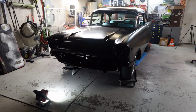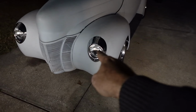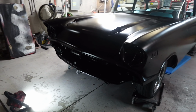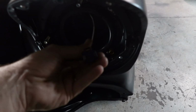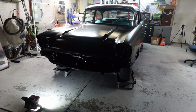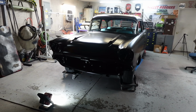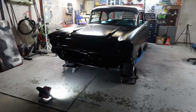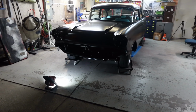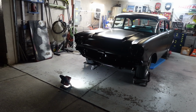And I'm going to send Don out to get me a regular set of headlights, these, from O'Reilly's or AutoZone or wherever he chooses. That's a 3-pin connector that will just hook right into there and not be a disaster. Because I tried to hook up the LEDs, it looks like it'll plug in, but it doesn't plug in. And I'm not cutting the brand new American Auto Wire harnesses and all that. It's just dumb. I'm not doing that. So give me some headlights and we'll get them in the car.